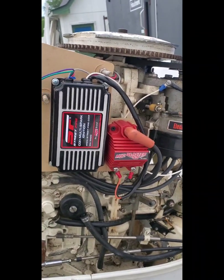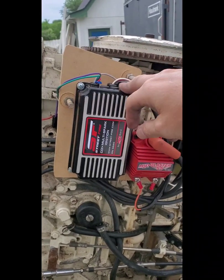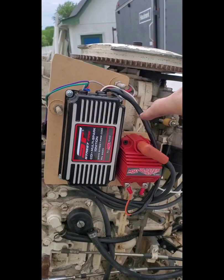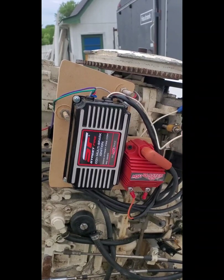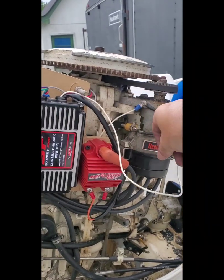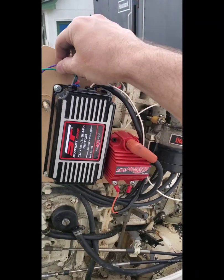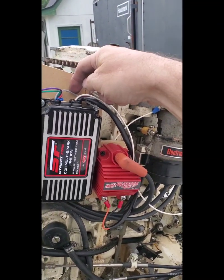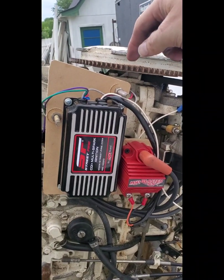Your CD has three wires coming out of it: a red, a white, and a blue, and a gray with a white stripe. The gray with the white stripe becomes the white wire that comes out of the top of the MSD. You don't use the purple and the green. The gray is a tach wire — it goes back to your white wire on your motor.